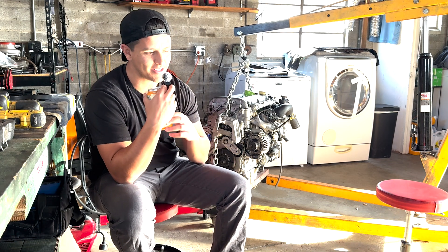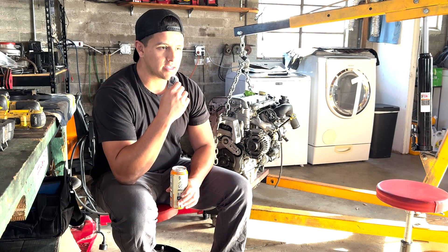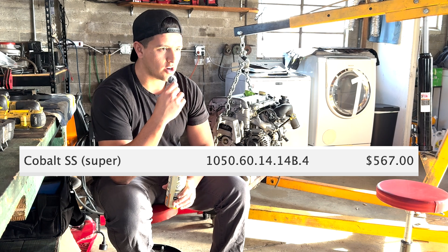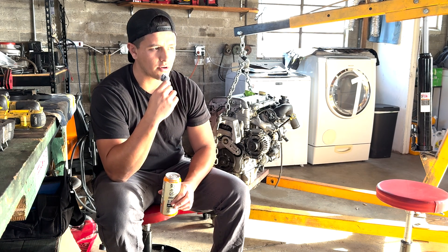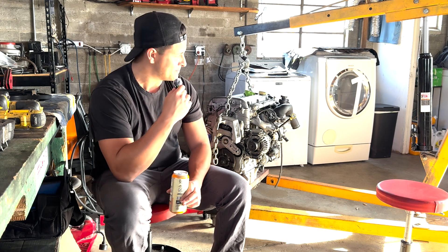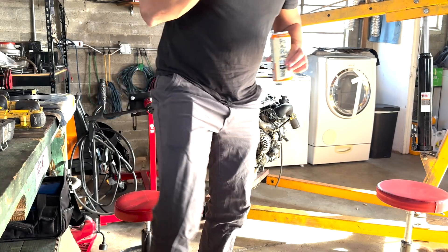The only thing I don't have for the car right now is a working ECU. If you have a T8 ECU you want to throw into the project, let me know. I'll also probably need a set of injectors — looking at Injector Dynamics 1050s for a Cobalt SS. I assume I need to upgrade the fuel pump as well. It's gonna be a Frankenstein build, but that's what we're here for — low budget 400 to 500 horsepower. Let's start fitting the parts.